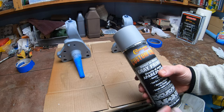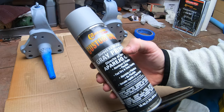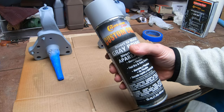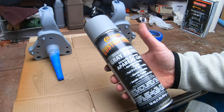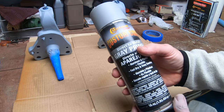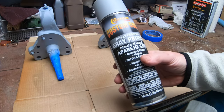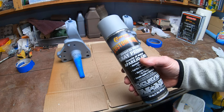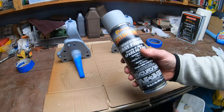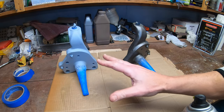So we're going to hit it with some etching primer. After one coat of etching primer, I followed up with Custom Shop Custom Coat — it's a DTM direct-to-metal gray primer. I really like this product; I've used it a lot on other projects with the car. It sprays incredibly and dries really quick. It says you can paint over it in 30 minutes, but we're going to give it a couple of hours to fully cure so there are no problems.